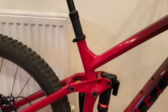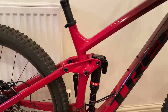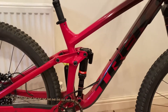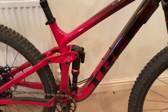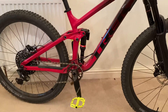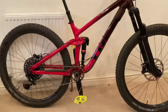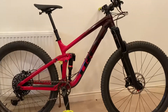Almost every Slash you look at, you can't get the seat post much lower. If you go up to a large or XL you might get more drop, but certainly on the small, medium, and ML you can't get it lower. I would have gone for an ML but I couldn't get the seat post low enough. The 175mm cranks are good for leverage climbing, but they're more prone to rock strikes and make it even harder to get the saddle down.